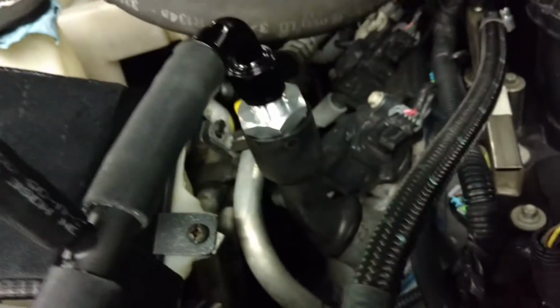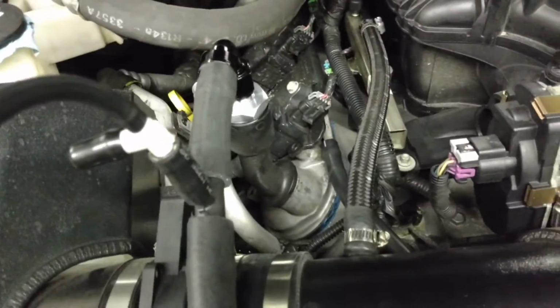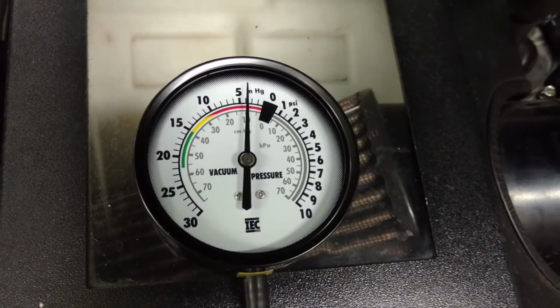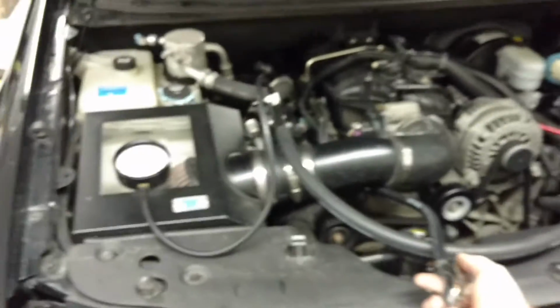And that's because we were able to, on the fly, you saw it in a matter of minutes, change this line so that we can now accept more crankcase flow out of the system while still keeping better than stock PCV, because with stock PCV you're not going to pull any vacuum at normal driving at all. So there you have it. Not much else to say.